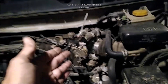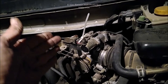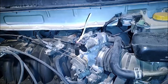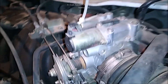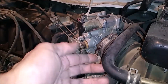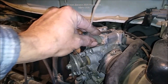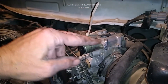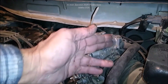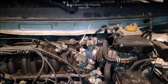This controls the idle at a set rate — you can see the screw is still set on its mark. What we're dealing with right now is this little unit here. Your car will have these in different places, but they'll have a little motor on it that draws it back and allows airflow through. As you advance more throttle, it closes that and allows it to go through the throttle body.